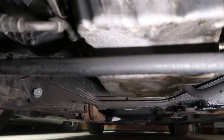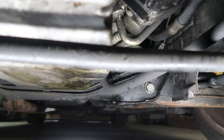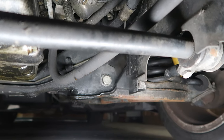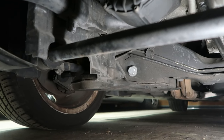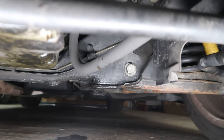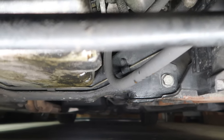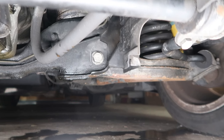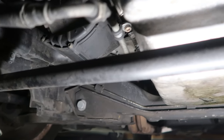Decided to pull the lower belly pan first and get an initial look. I don't mind the wetness over there — it's quite drippy from the washer tank — but you can see the lower control arm has probably been getting dripped on for a long time. One side is totally corrosion-free, but the other has a ton of surface corrosion on it, so we'll be addressing that. Luckily it's just the control arm assembly, not any part of the frame, but it looks a little crunchy.